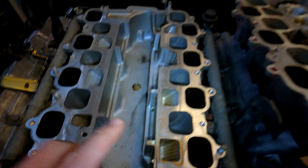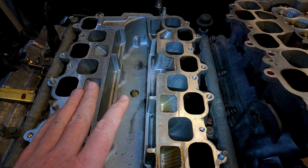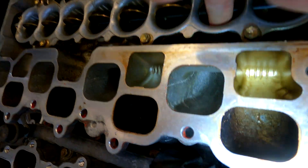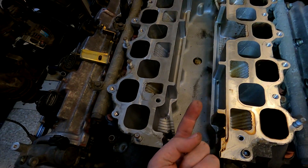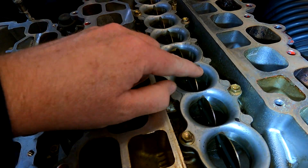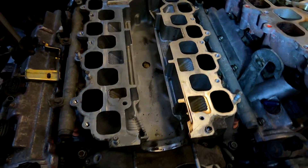There's another video I'll try to find where it's demonstrated on paper with actual Toyota documentation of exactly when and under what conditions these valves open. But basically, at higher RPM these valves open. If you shine a light in there you can see — there's my finger over there — the air is coming in and going straight up and then straight across, so it's effectively half the length. You're cutting out the whole long section and going straight through. So at higher RPM the open valves effectively halve your intake runner length, giving you more horsepower.